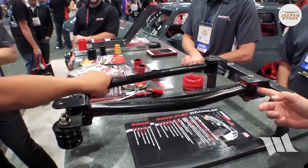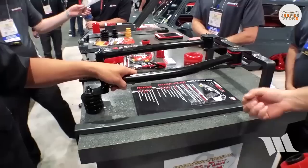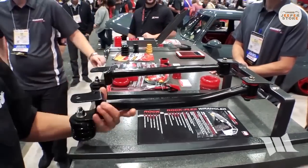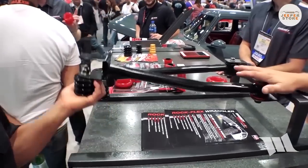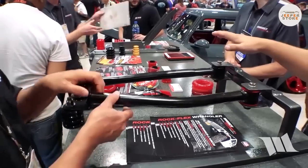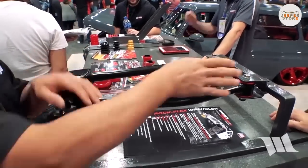Right, the more you go, the more it resists. Yeah, and then you hit this guy. Oh, shoot. Crank up on it. So each of these gives an additional 25% of articulation in the factory arms with the factory metals over the OE rubber bushing. No kidding. So the question is, do these need to be greased in order to stay quiet? No, you don't need to service them. The only thing you do need on install is to grease them on the inside.